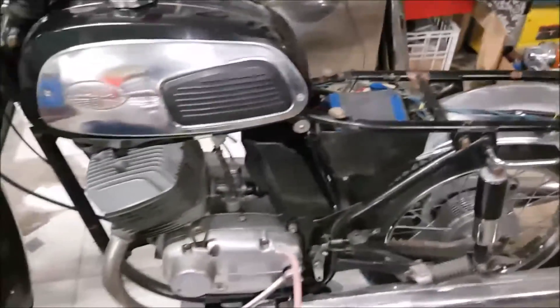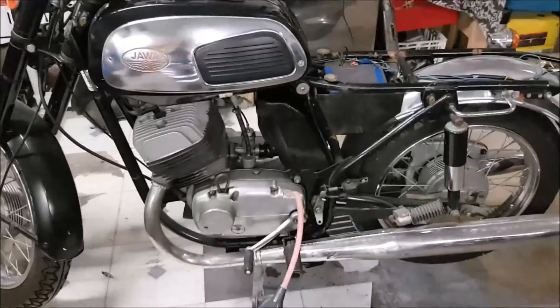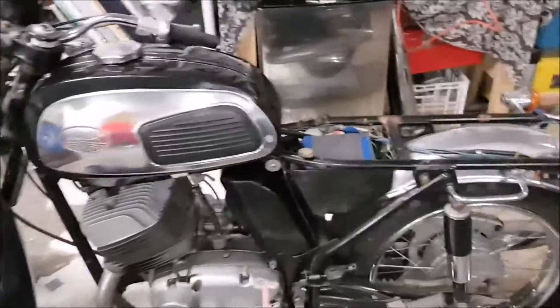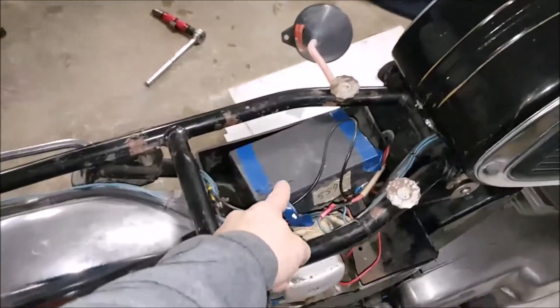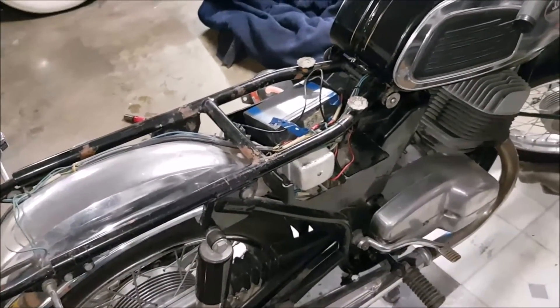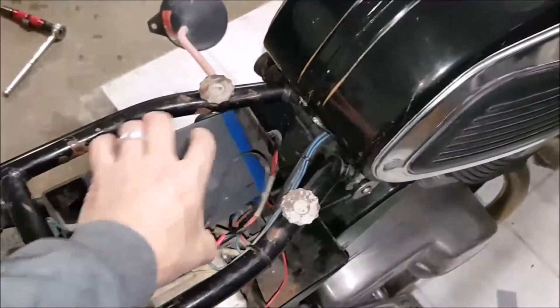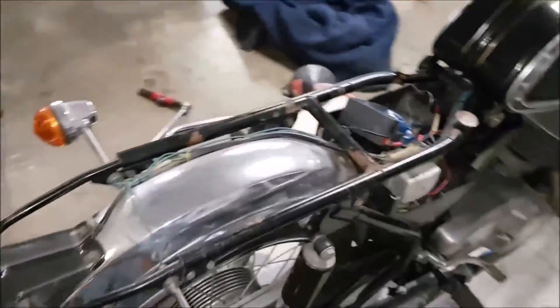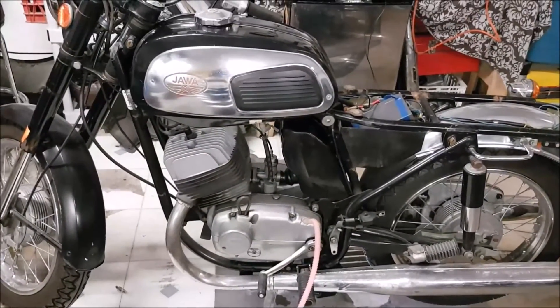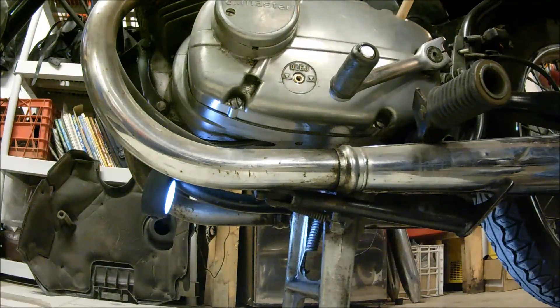As you can see the battery is in place — that's a 6-volt battery. I stated earlier it's a 12-volt bike but I was wrong, it's a 6-volt bike, positive ground. It's a 1978 bike with 6 volts. That's a camcorder-style battery — you can get it at any used battery place, dirt cheap, way cheaper than a lead-acid battery. It doesn't mind the cold, doesn't mind being cycled for charging. The first liter is in there, so it should take no more than another 0.2 liters. Watch that hole and tell me when oil starts coming out.